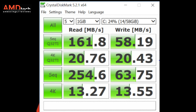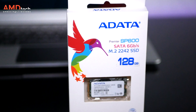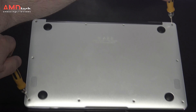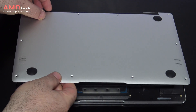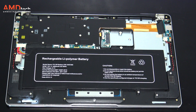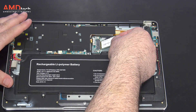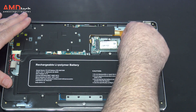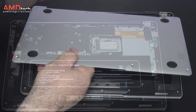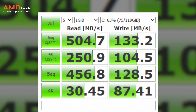That's why I recommend you do the SSD installation. I went with the ADATA 128GB M.2 SATA drive, but I recommend going with something like Transcend which gets better results. Installation is very easy: remove the 10 screws from the back plate, remove the back plate. Inside you'll notice the engineers at Jumper did a very good job — nice tight clean innards. Remove the one screw, insert your M.2 SSD drive, make sure it's seated securely, fasten the screw back in, screw your back plate on, and that's it. Then you can install Windows on the SSD drive — just change the boot order in the BIOS.